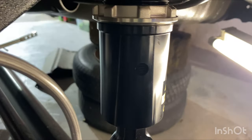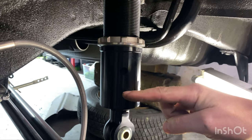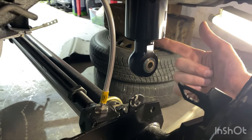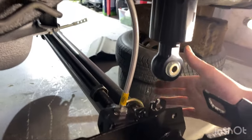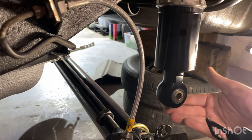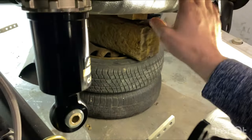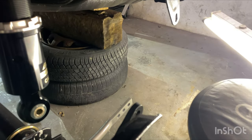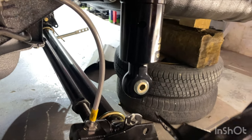So you have the full depth of this collar — probably about three quarters of the way down — of adjustment up or down. It's already an awful lot; this is going to make it an awful lot lower. What I'm going to do is pull out the other shock, get it in the same position, and throw the jack under the center of the axle to bring it up to meet this point. This will probably also sort my issue with the rear anti-roll bar being too low to mount into the chassis. One of my mates who is a welder is going to come and we'll make up some brackets, weld them into the chassis, and get the tie-in pin for that into the chassis as well. So I'll get cracking on the other side and then throw the bolts through — looking a whole pile better.